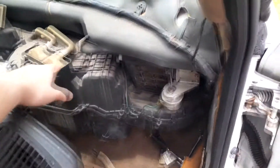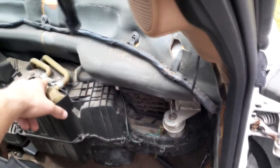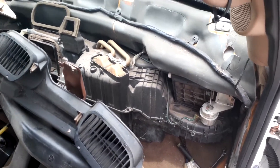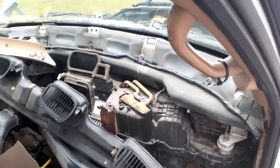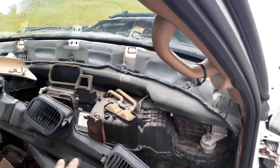So as you can see, this is your heater core right here. Looks like it's held in by two screws and there's a random ground right there. This side is pretty easy — all we're going to do is undo the two screws. The new style heater cores actually have rotating arms, which makes it a million times easier to get these things in and out.